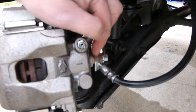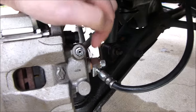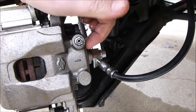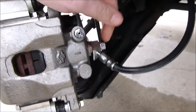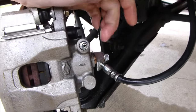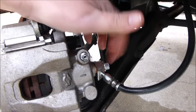The actual hose end has grooves on both sides — same principle. In this case, one side just relies on pressure. The problem was that even with the grooves, it would not seal. You can't tighten these too much — if you don't strip them outright, you can still damage the brass fitting. This one is rated at 16 to 23 pound-feet, and if you try to go more you'll strip it out.